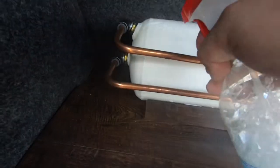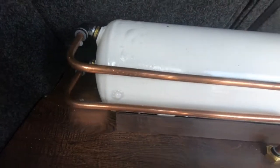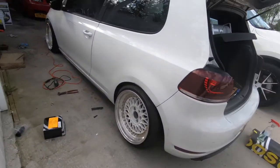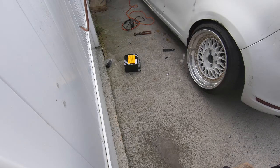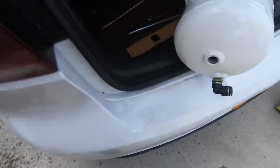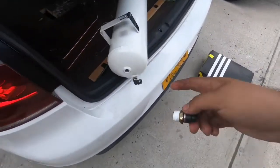I came to the tank and I hear something. As you can see, this is where all the air is coming out from. We got a new replacement tank. I removed the bottom plug to see exactly how much water was in there. I just want to show you guys what moisture can do — this is pretty disgusting and the whole tank looks exactly like that inside. I cleaned it up and put some Teflon around the threads.